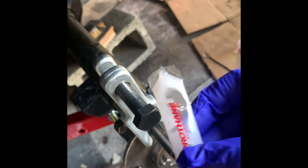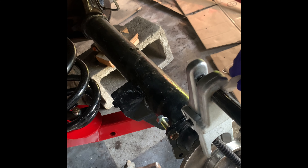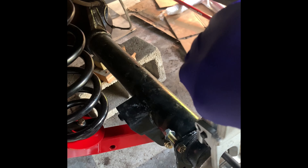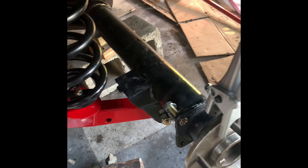Just another quick tip here for the ball joint remover, which I'm using as a presser to press in these wheel studs. You always want to make sure that you have this thread here nicely greased. I've learned to do that from damaging one I had before. I'll place some grease in there and as I impact it, it actually helps and makes a big difference — greasing these so you don't damage them.